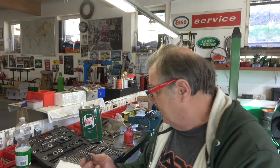It's fitted. He's just putting the oil into it because we serviced it as well. Yeah, and put a new copper ring on it. But it's one of the things. So if you've got an aluminium sump or anything aluminium, be very careful about tightening it.